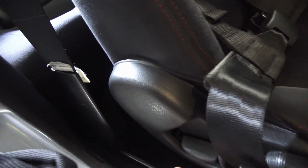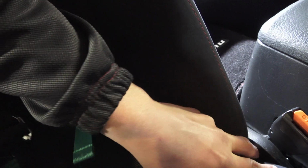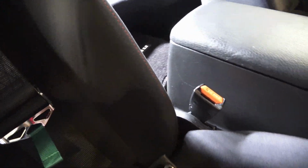And then this is gonna secure to the bolting point down here. And then the back ones will go into where the seat belt attachments are. So I'm gonna go ahead and remove the bottom part of the back seat so I can get those in. And I'm gonna also have to unbolt the front seat because I need to attach this bracket into here, which there's no access to get to that. So I'll go ahead and undo the bolts, get that done, and we'll check it out.